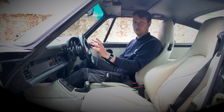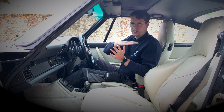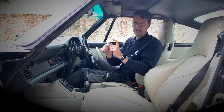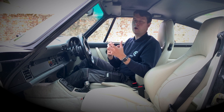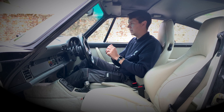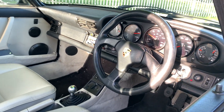The main changes are the five gauges, which now do slightly different things. Left to right: battery temperature, motor temperature, battery level or state of charge, then a kilowatt gauge in the center — almost like a rev counter — showing amps going out to the drive unit and amps coming back in through regen. There's also a small display showing estimated range, kilowatts per mile, what gear and mode you're in — chill or sport. The fourth gauge is miles per hour, and the fifth shows 12-volt and EV battery voltage up to 400 volts. They have integrated LEDs for indicators and beams, sitting in the original holders.